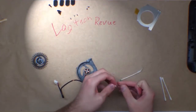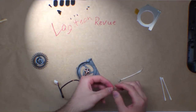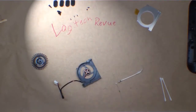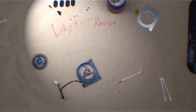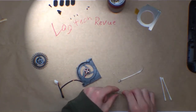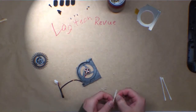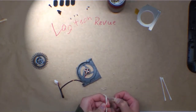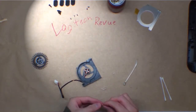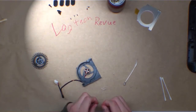I don't have any high-speed lubricant. Although this is a fan which usually runs at high speed and high-speed lubricant is best, I don't have any. Low-speed will probably be fine because this is directly in the middle and not around the edges. It usually runs at idle, so it's only about half-speed anyway.